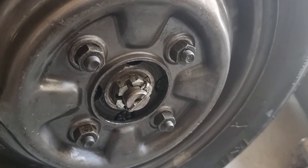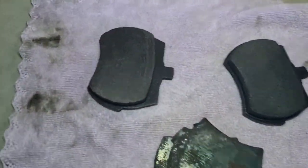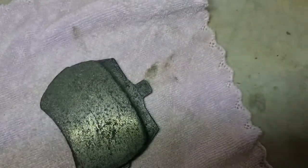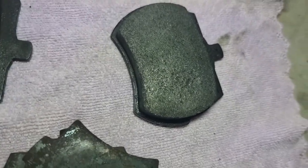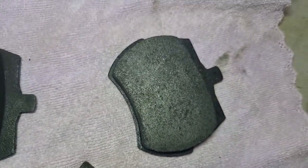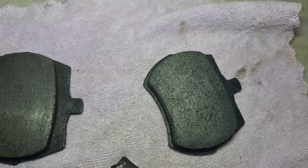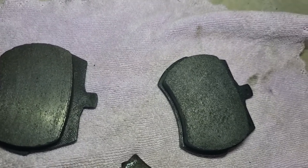With a good clean up to decontaminate — ideally you would have new pads. The one I'm showing you right now is the one that wasn't contaminated, and this is the one that was. It hasn't become ingrained in the pad so I think it'll be right. Certainly if I do experience any braking-related issues, what I would expect is that if the performance of this side isn't as good as the other, I'll get a level of pulling to one side. But given that it was completely contaminated before and I wasn't getting any pulling, I think we'll be fine.